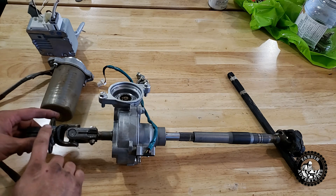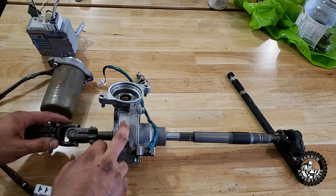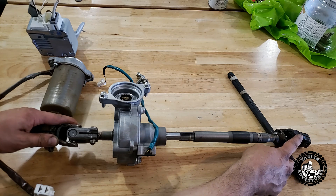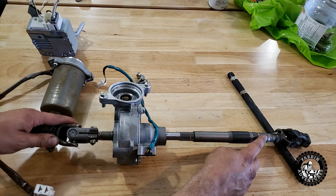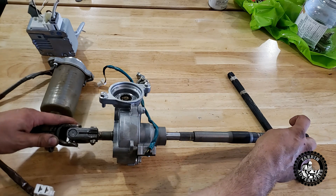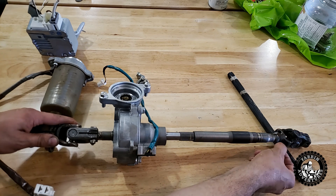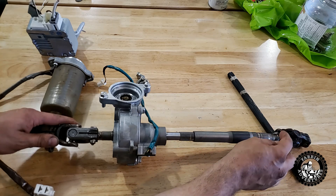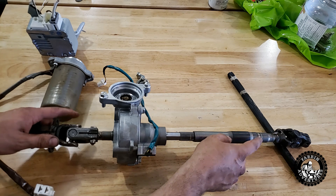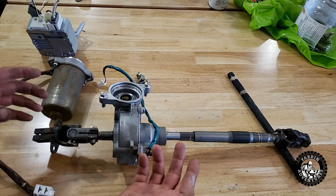So here's the finished product. This is the rag-joint part that comes off your steering box, welded to the U-joint set that this little power steering unit comes with. This is the U-joint that comes out of the firewall from your steering shaft, welded straight to the shaft like I showed. I've drilled a little half-moon in there so I can still put a bolt through there as an extra safety measure — so if the weld broke, which it won't, the shaft still can't come out. You should still have some steering, and there it is. We're basically ready to mount it in the Zook.